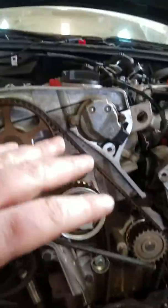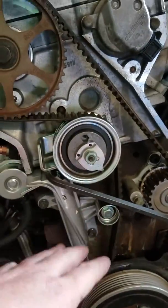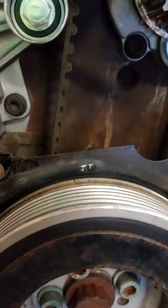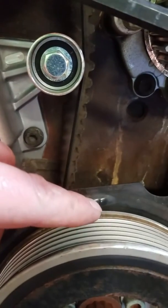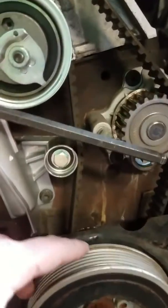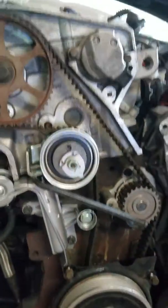The way to compensate for this is you don't need to count teeth, you don't need any of that. When the belt is tight and you pull up on this lever, it will be wrapped around the crankshaft sprocket and everything will be generally lined up. The trick to getting the belt on the correct tooth is quite simple: down on the crankshaft, move the indicator on the pulley back about three-eighths of an inch from the stamped mark on the cover. That obviously won't be a perfect top dead center, but you don't need it to be, particularly because the camshaft sprocket is also out of alignment by the way it naturally sits. If you move it back about three-eighths of an inch, the belt will go on easily and be pretty close to the correct timing.